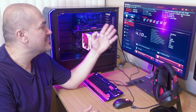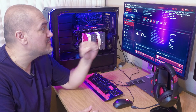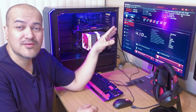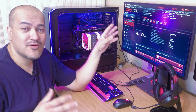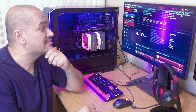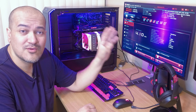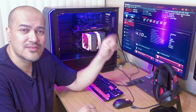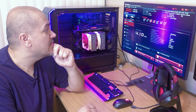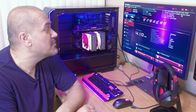Here's the MSI BIOS. It's running at 4.1 GHz, which is the rated clock speed for the 10600K CPU, and everything looks normal. The RAM is running at the 2133 MHz base speed, so I'm going to enable XMP to get that running higher. I'll make sure UEFI is set up correctly and enable XMP to get the RAM up to speed. The BIOS build date is May 21, 2020 — pretty recent, so I shouldn't need to update it.